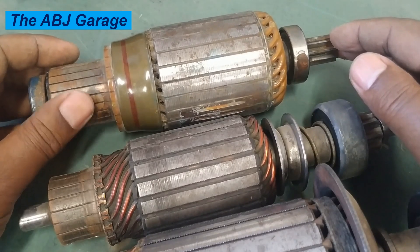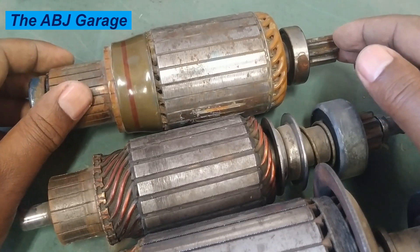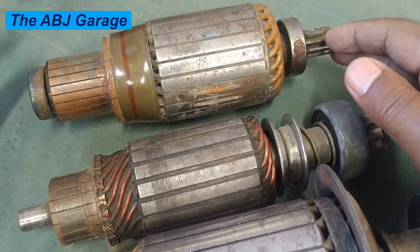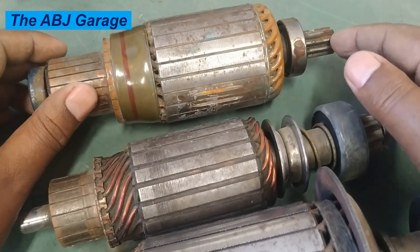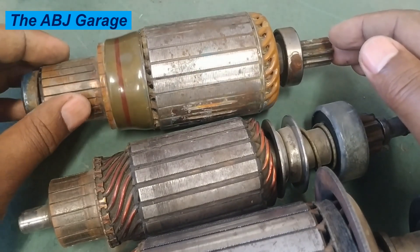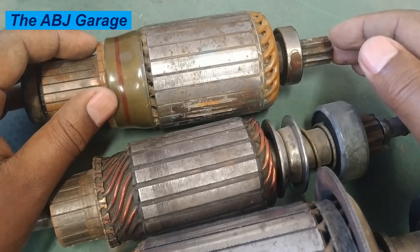When the armature spins unnecessarily, it leads to overheating and wear. Prolonged cranking — whether due to faulty use of the ignition key, a sticking relay, or a faulty ignition switch — can be very deadly to the armature.